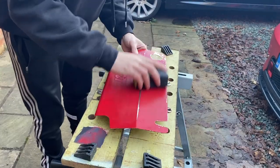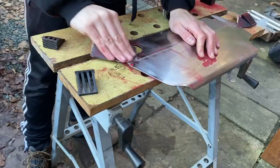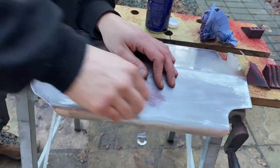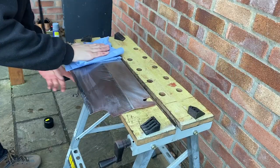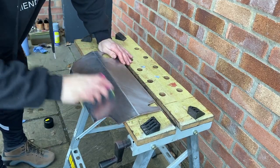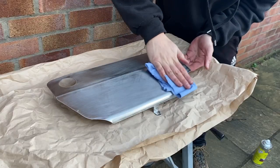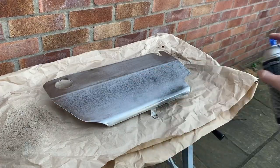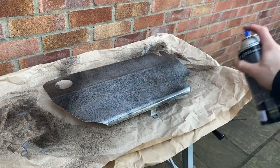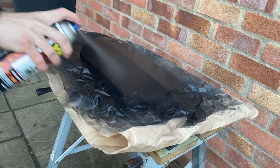So I pried off the ST badge and set about removing all the old paint — it really wasn't difficult because this thing definitely wasn't prepped before painting. The paint came off so easily. I gave the cover a wipe down with panel prep, then went over it one last time with 120-grit sandpaper to give the surface the best key and the best possible chance of the paint sticking, especially on this shiny surface. One more clean with panel prep and it was time to spray — I went with a satin black VHT engine enamel, because this is likely to get quite hot sitting right at the top of the engine, so a proper engine paint made sense. The satin black should also tie in really well with those other covers from Paint Mods.